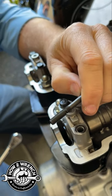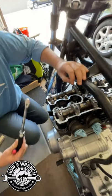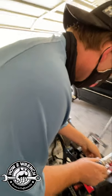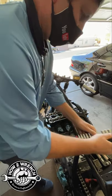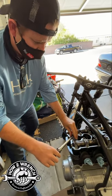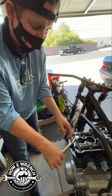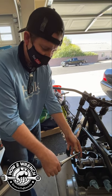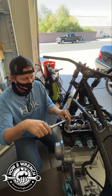Isn't that crazy? Talk about lucky. If it came out like the other one, not the end of the world, but we definitely don't want to be doing this. So let's do a recap of what we can do to prevent this. On these small fasteners, I would set the torque wrench assembly in the pattern on this one. I'd recommend doing it by hand first, then I'd do half torque — so if it were 96, I'd throw it at like 50 — because that's where you'd start to catch a problem.